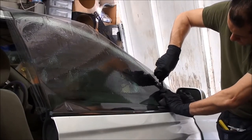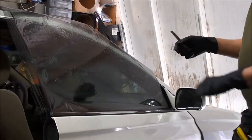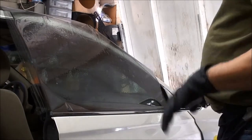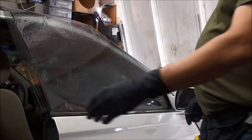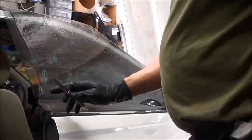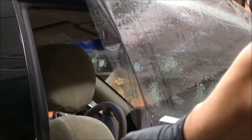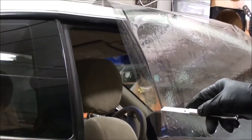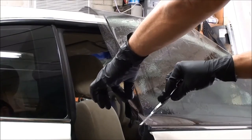Come up — it kind of curves right at the end. Then get your film and pull away as you rip it. You'll have a little ear right on the corner — we'll trim that later on the glass. Now we go to this corner over here. I'm going to trim it here with my blade. I like to start at the bottom, so I'm going to first notch out a little piece so I can start my blade.